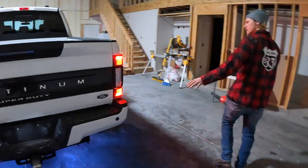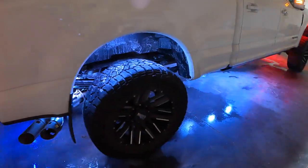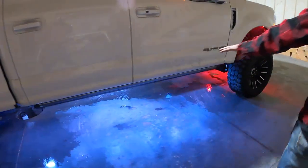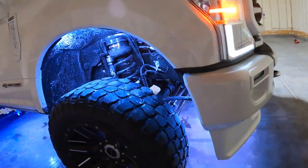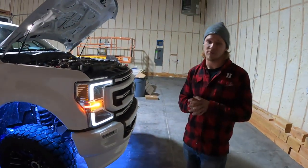You're going to have to get a little creative — there's no real wrong or right way to do this, as long as you're doing it clean and making sure there are no wires exposed under fender liners or under your body. Make sure nothing is touching heat sources in your engine bay or exhaust, because it'll melt the wire.